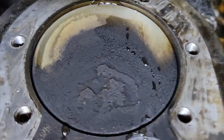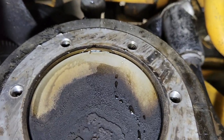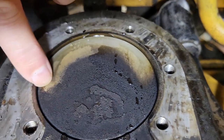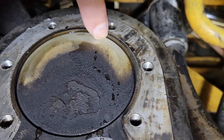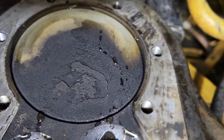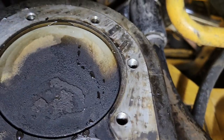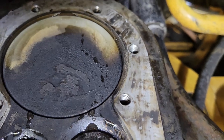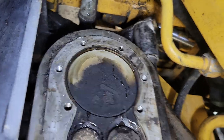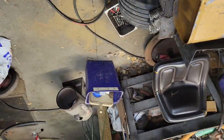This one's not horrible on compression blow-by, but this area right here is what they call piston wash, and that's an early sign of blow-by. What happens is while it's compressing and firing, a little bit is leaking by, and that's why that part of the piston is clean. Very common on this flathead style engine.